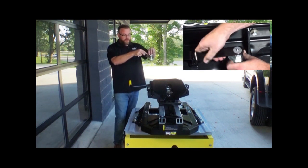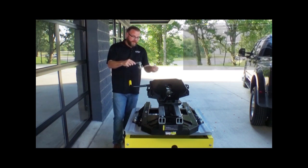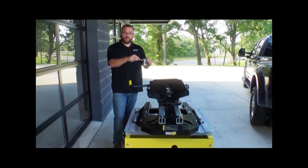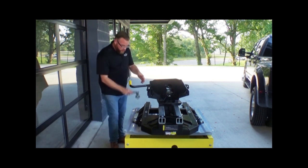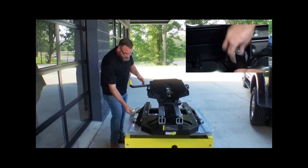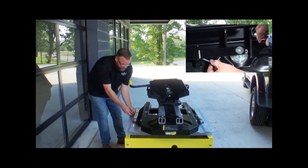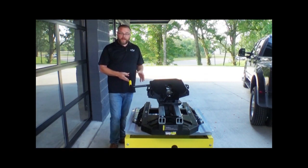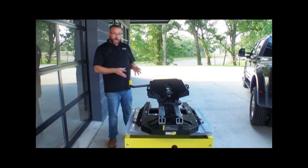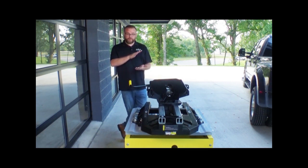The idea here is that we want it to clamp the hitch down onto that puck system, so we're going to adjust these down nice and tight according to the truck, and then slide this cotter pin right through there and bend it out. This really is the key ingredient that makes this product extremely easy to put in and out, because once we slide this hitch into position and lock it over those four pucks, we can just drop the post down through the structure of the hitch and lock it into place just like that. We also include bail pins that lock the handles together, which can easily be swapped out for a padlock if you'd like to lock this hitch into the bed of your truck. All of our OE Superglides and OE hitches are going to use a very similar mounting post like that, that locks the hitch firmly into the bed of the truck.